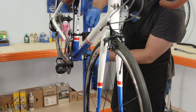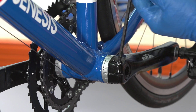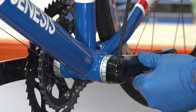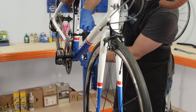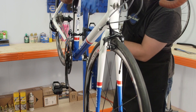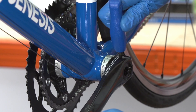Finally, tighten and torque the bolts on the crank. These need to be tightened as a pair, so wind one until it becomes tight, then repeat with the other. If you have a torque wrench, tighten to 10Nm both sides, then 12, 14, and so on until you reach the stated torque.